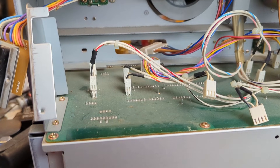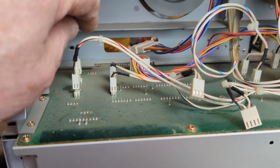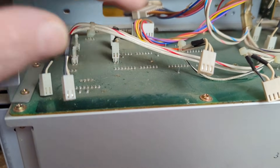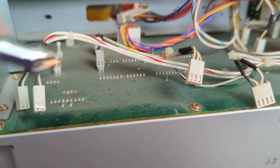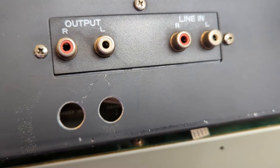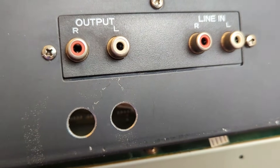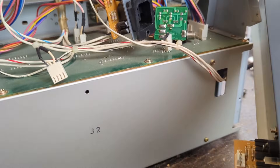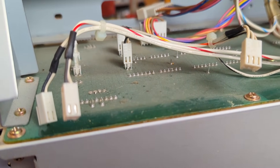I do have to blow the dust out of here, but what we did was follow the reproduce head wires — I'll show you on the other side — to these two wires right here. Those unplugged from the board and we're going to cut those wires and solder them onto RCA jacks. We're going to add these two RCA jacks into holes I drilled on this back plate, sitting right below the factory output jacks, which will still be connected to the center head. We're just pulling the wires that go to the reproduce head and hooking those up to some external jacks.